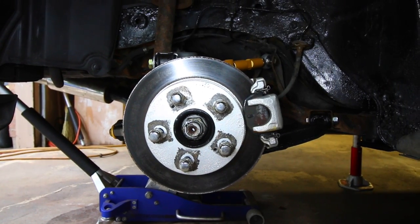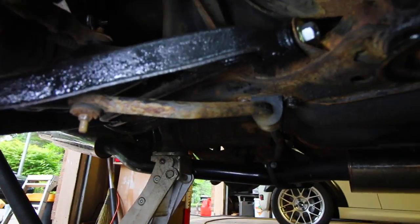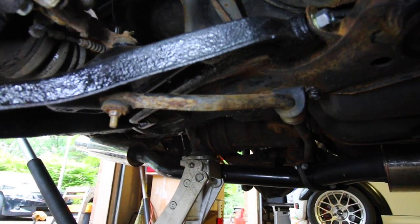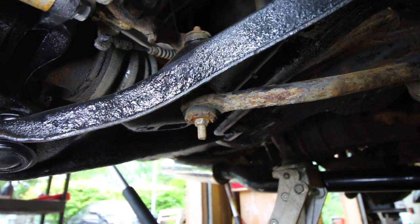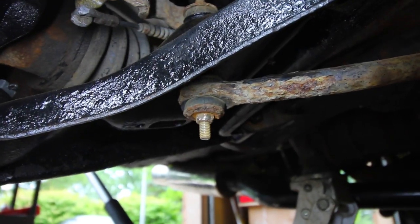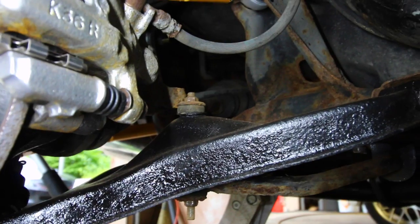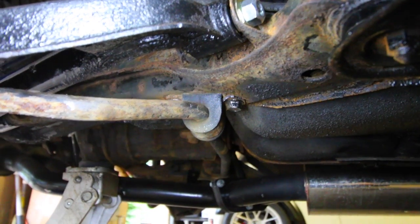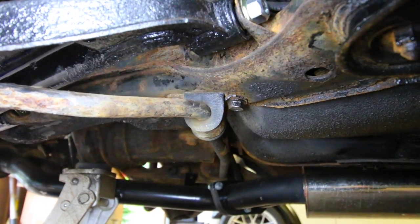If we take a look at the passenger side rear of the car and try to find our sway bar, it's going to be down here — that dinky little bar right there in the center of the screen. That needs to come out along with the end links found there and on the exact same spot on the driver side. We have a 12mm nut on the bottom and a 12mm nut on the top that we need to remove to release the end link from the sway bar. Then there are two bolts holding the bracket down that secures the bushing and the sway bar up to the subframe.